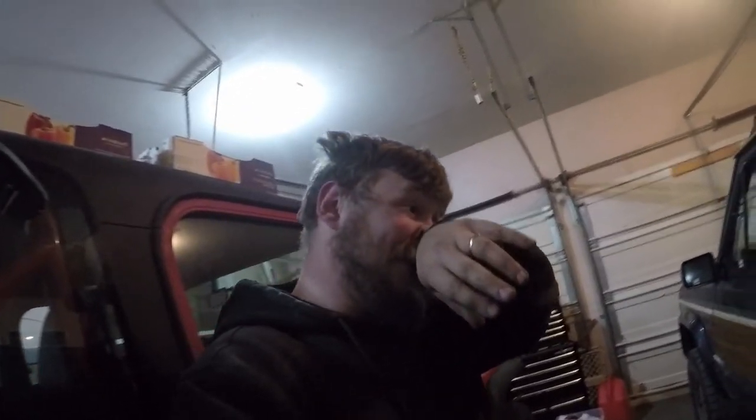We do have a small transmission leak. It's a drip. I'll show you now. I don't know if you guys will be able to see under there, but there's a bit of wet floor. It's a very slow drip. I bet if I shoved some RTV into the piece, it wouldn't drip, but either way, it's ATF+4, it's cheap, so it's a low drip, it's not a big deal to me. Transmission's full, so we're good, and we have an extra liter of Mopar ATF+4.